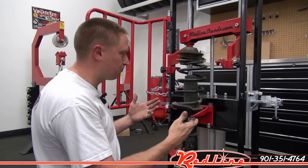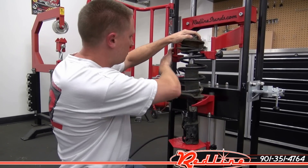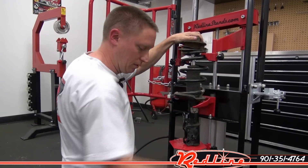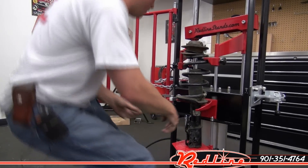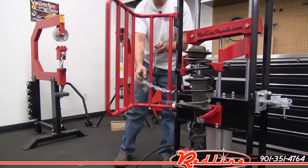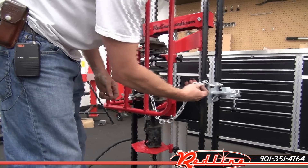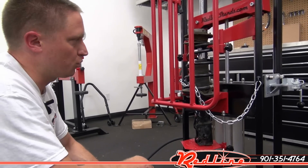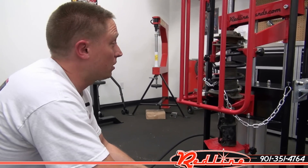So let's go ahead and do a little bit of a presentation here. We'll bring our arms into about where they need to be. I'm just going to put a little pressure to bring them in place and lock them in. I'm never going to run off and put tons of pressure on this with me standing here without the cage in place. So now I'm going to unhook the chain, let the door close. I'll take the chain and run it through the strut and latch it on there — so that just in case this spring were to come unmounted, it won't shoot across the shop. I've actually seen that happen with cheap spring compressors. Now that I've got it in there, I'm going to compress it all the way and show it operate.